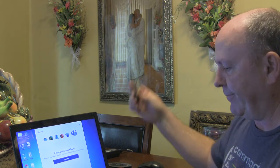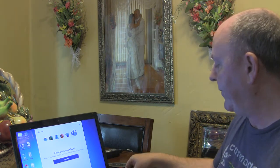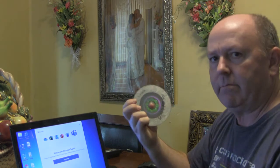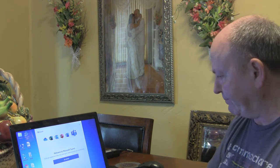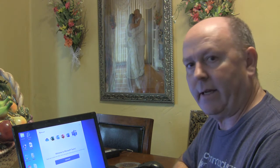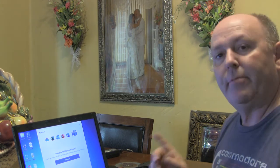My business Mountain Computers has changed four different times in 15 to 17 years — for better or worse, we're still here. Anyway, I just wanted to show you this Gateway NV55C laptop: cloned the drive, changed out the RAM to two 4GB DDR3-12800 sticks, put in an SSD. I used a Windows 7 Pro 64-bit CD to repair after the clone. It's an i3 processor at around 2-point-something GHz, works great. I'm going to use this as a traveling laptop. Be sure to like, subscribe, and share — this is Andy from Mountain Computers, have a great day!